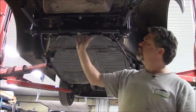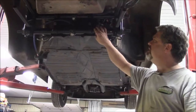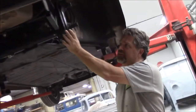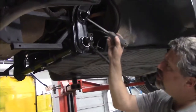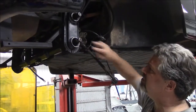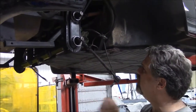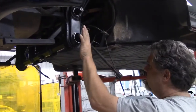We've removed the rusted-out, cobbled-up beam. We have the new beam in here now, and we have a bunch of new components coming. On the end with the torsion pieces, we've already got this set up. Now that these are in and adjusted, the next thing we'll be doing is replacing the seals — they're German-made seals that go on the ends — and then we'll be installing the new spindles and disc brake conversion kit. So this is basically going to be all new in here.